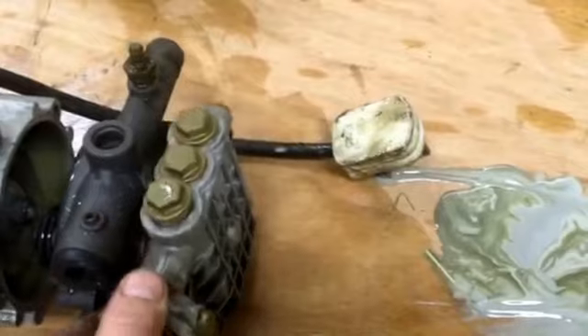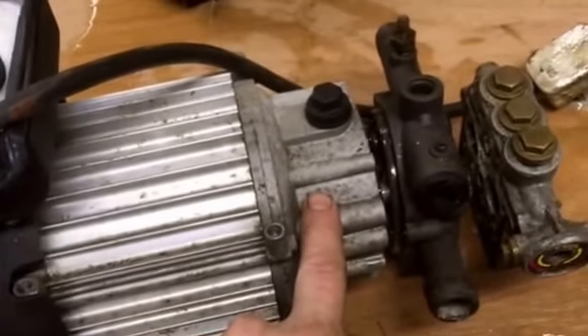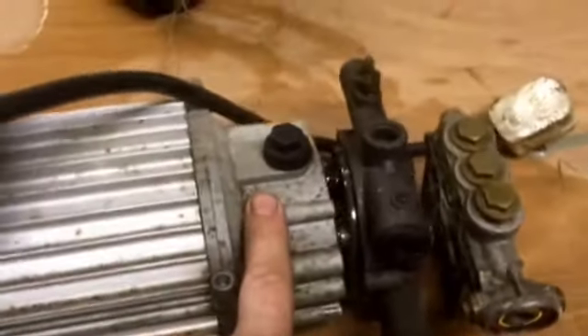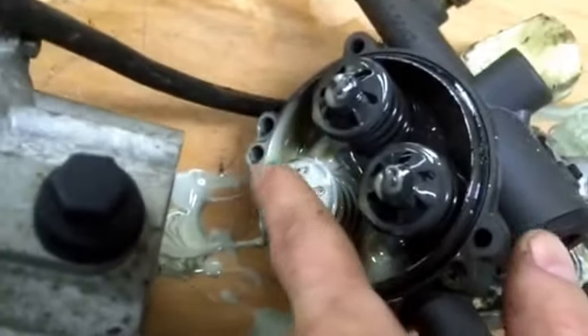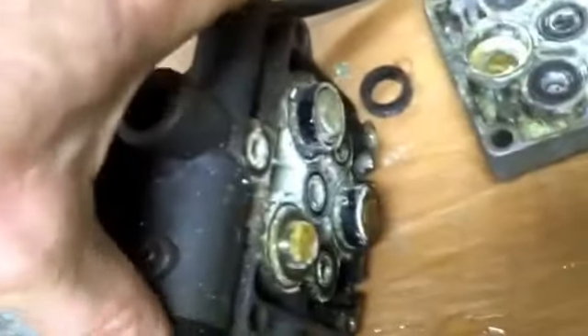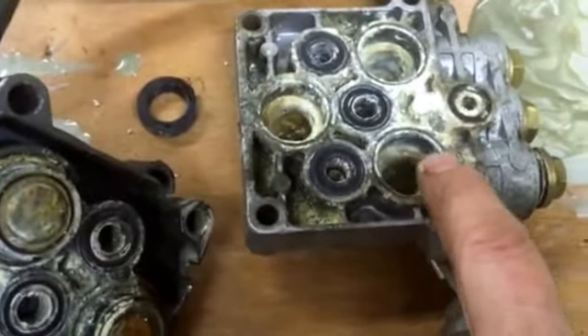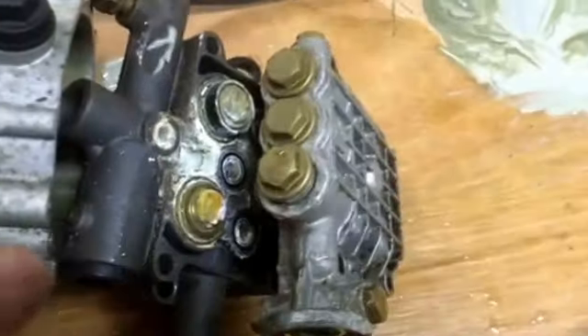Here are the basics of a jet wash. We've got an air-cooled motor, a gearbox, pistons, and a non-return manifold. This spins, reduces its spin with a gearbox, which rotates an elliptical plate that hammers on and pushes these pistons down into chambers. That pressurized water is sent up through each one of these non-return valves and out the main pressure line.